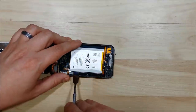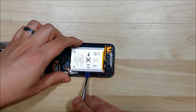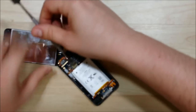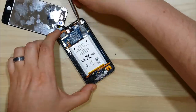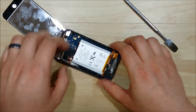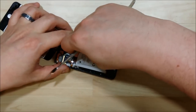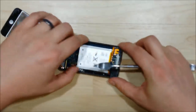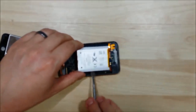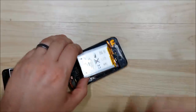You don't want to rip the copper foil, so pry slowly across the side to start pulling the battery up, then pry towards the bottom and on top of the copper to make sure it's not going to tear when you pull the battery up. Be nice and gentle as we loosen it. We want the battery to become free so that when we remove the solder it's easy to pull out. We do have a little bit of give in the battery cable as well. Now the battery is completely free.